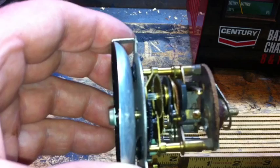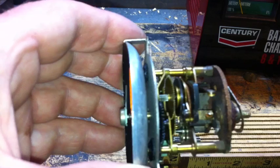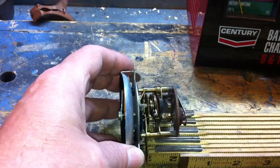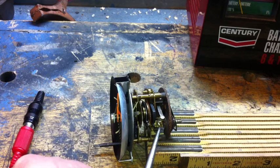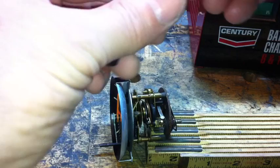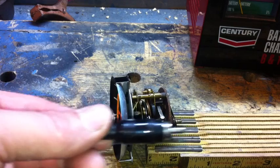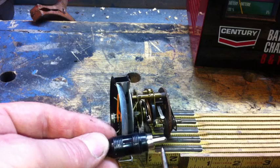What I wanted to show people is you can just file these points down, usually with like an emery board. Mine were so toasted I couldn't do that — I had to make a new point and put it on the bottom right here. I'd read on the internet about a guy who just put a blob of solder there, but that only lasted a few days running 24/7, and solder is not designed for that — it burnt away within about three days. The points are riveted on from the factory so you can't easily replace them. What I did is get an RCA cable plug and cut a section out of it. Don't use the rounded top because points don't come with the rounded top — I guess that makes a difference.